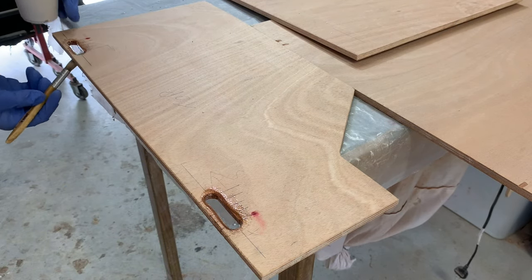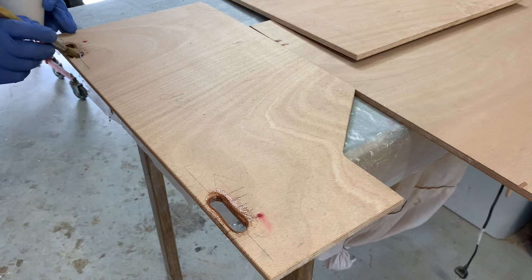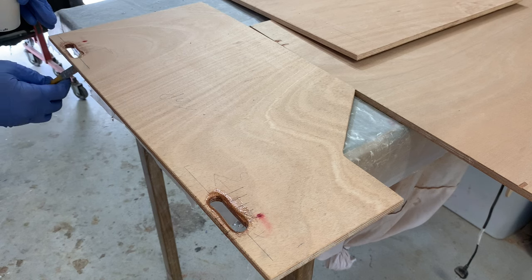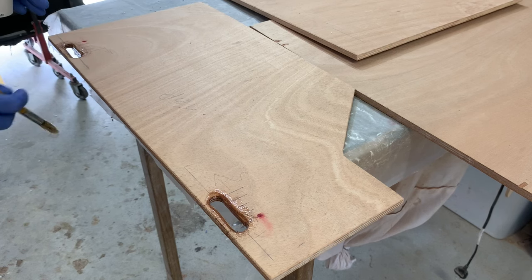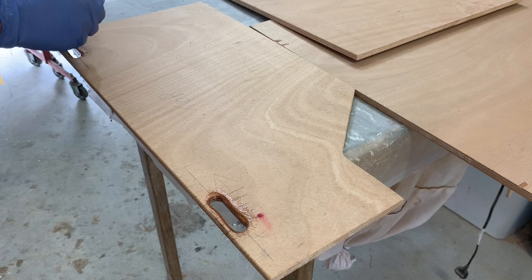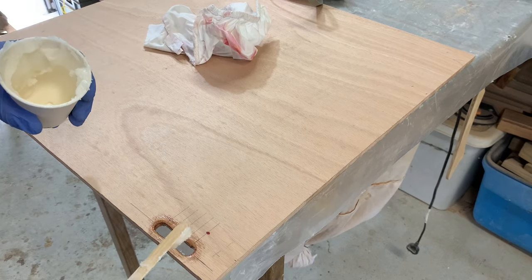Right, so you don't have to be particularly accurate when you're doing this sort of cutting and what have you. That's once you drill the final holes that you need to work a bit more accurately. Effectively, you're just taking this pulpy soft wood and replacing it with a nice, strong and waterproof substrate into which to put holes, I guess. So I think we'll get started, we'll get some out of the mug.